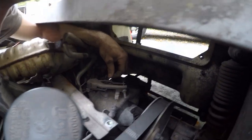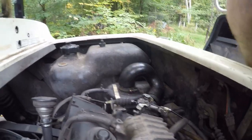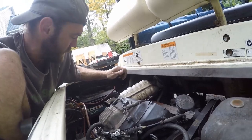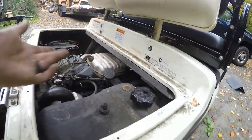It's pulling this back all the way. If you hit the gas pedal and let go, it'll go all the way back — it was staying open, which will cause the engine not to shut off when you're driving, and that's really annoying. Everything seems to be working pretty good now. All the adjustment nuts went all the way back and that gave me a little bit of slack, and everything is adjustable from the back. Can put the muffler back on and give it a test — that was the hard part, getting it in there.